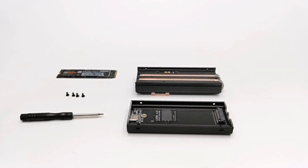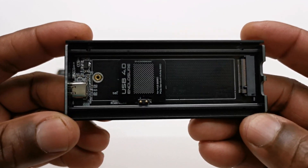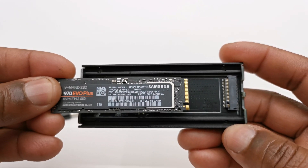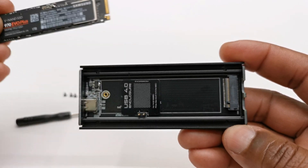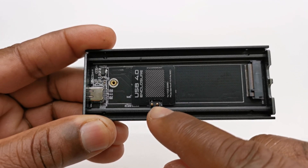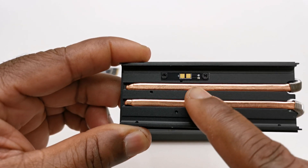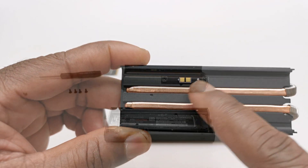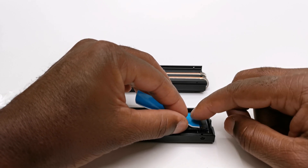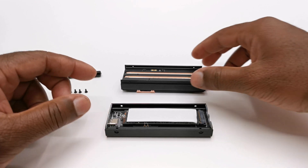Once you remove the four screws you gain access to its intuitive design. It has an M.2 slot that only supports a single 2280 M.2 NVMe SSD — M key type. It has a cable-less design to power its cooling fan utilizing connector pins when you close the enclosure. Once you install your SSD and secure it, you simply apply the heat pad to its surface and close the enclosure, and it will make direct contact with the SSD.